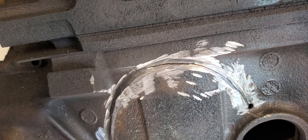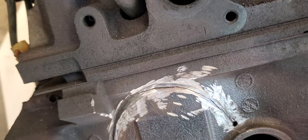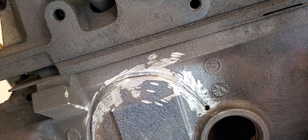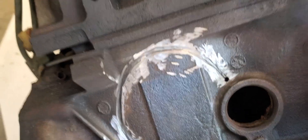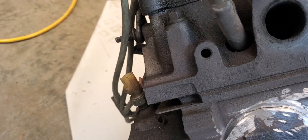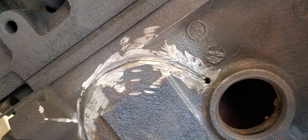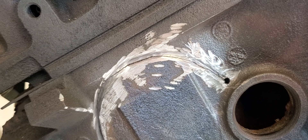As you can see, really bad, bad crack. I have welded cast iron before — manifolds and blocks — it's not easy. Just inside this metal jacket are nodules, and this is on the cooling side. Obviously that's why it broke: they didn't have antifreeze, just water. So I drilled it right there to stop the crack before it gets to that freeze plug and port.